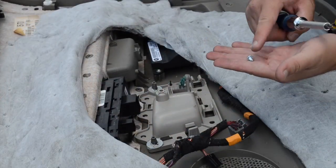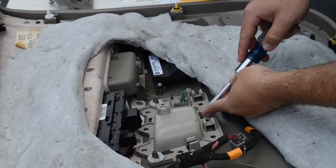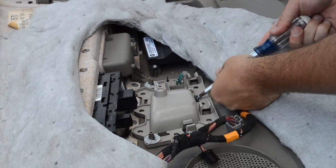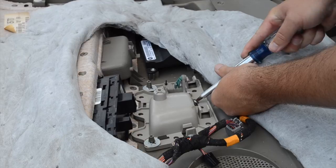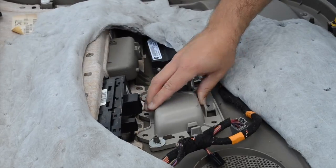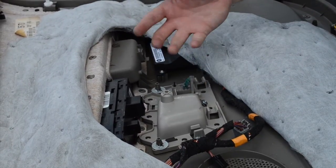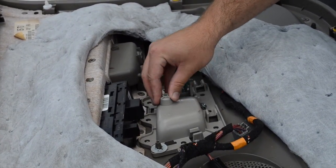The next step: you're going to use one of your screws and your Phillips head screwdriver. What we're going to do here is locate this tab that's on the bottom of the housing and work that screw in at an angle, just like that. Once that's snug, you'll see that this is nice and secure — you can actually lift the whole door panel. Some kits will come with extra screws and a washer; those can be used in the old rivet points. They're not really necessary, but it makes some people feel better and will help secure it to the door panel.